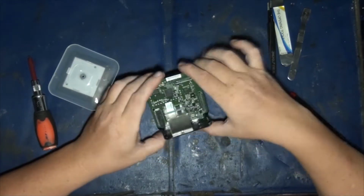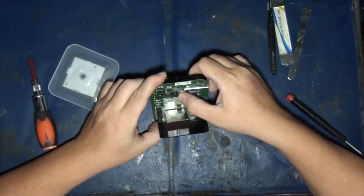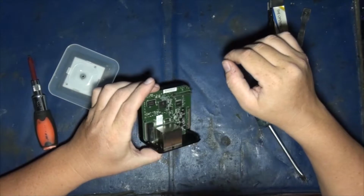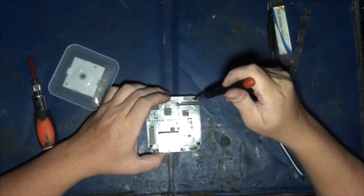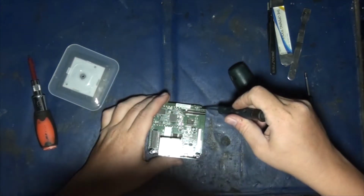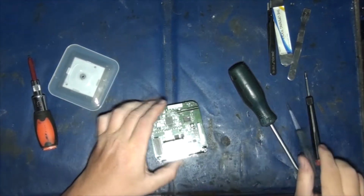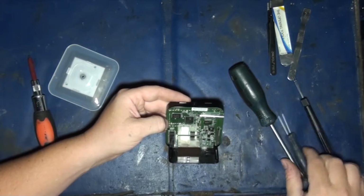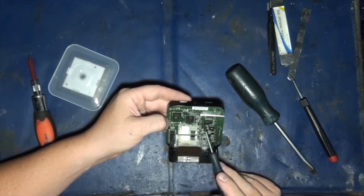Okay, so right here, see here, that is a Qualcomm Atheros QCA9533-BL3A. Yeah, that is the processor, nice. That's the end-all be-all. It kind of does everything for this little guy. I haven't actually taken this circuit board off, but it looks like somebody else has. Those screws are just stripped. So let's grab a little tiny screwdriver here. They are so stripped. Oh my, I can't even take them out. Somebody has been in here prior to me. But anyway, these are the main guts. There's your hard drive, there's your everything else. Right there is your RF circuitry.